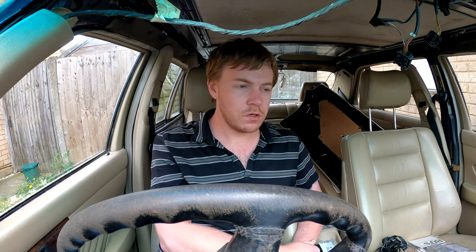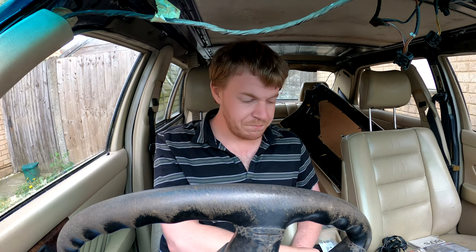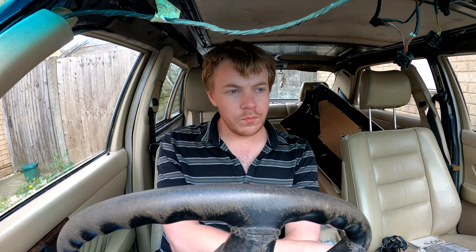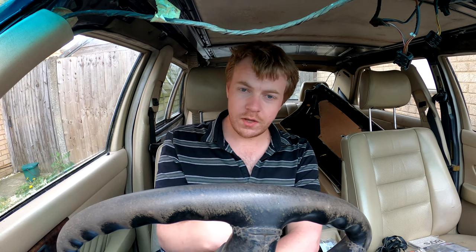So today in this video, I'm going to be tackling a job on my 190E. When the car broke down, the recovery company that came out to look at the car was doing all he needed to do to have a look. He undid the air filter housing to see if that could have caused an issue. Well, there wasn't anything in the air filter housing to prevent the car from starting. However, we did notice a different problem, which was quite a bit of oil sitting at the bottom of the air filter housing. So what's happening is the oil is being sucked through the breather hose from the crankcase, or from the cam cover head, and then coming through there and being deposited into the air filter housing.